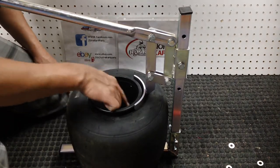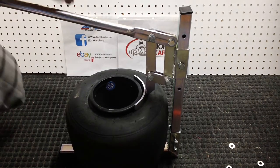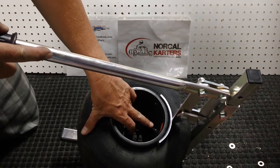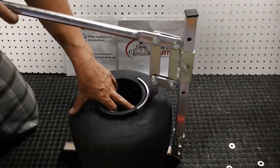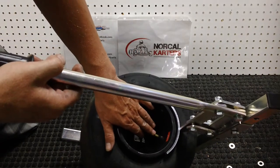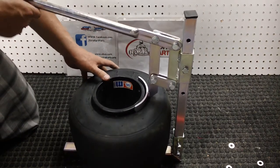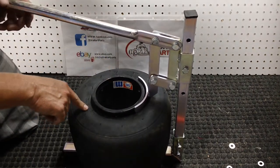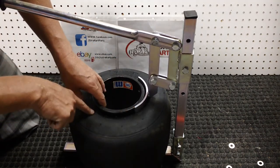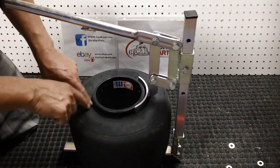The other thing you want to look out for — right here is the valve stem. You want to be very careful that when you're breaking the bead down, you don't want the tool lined up with the valve stem. You want to rotate it away from the valve stem. The reason is if you're pushing down and it breaks loose before you have a chance to control it, what can happen is you can break off the backside of the valve stem with the tire itself.